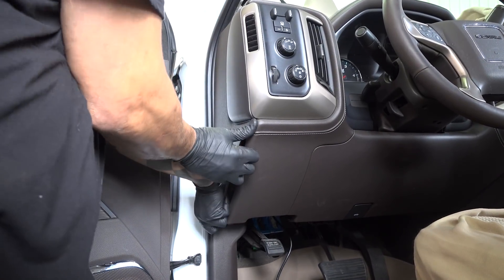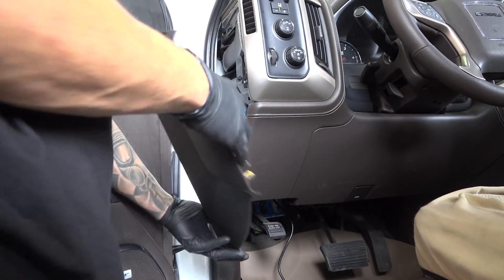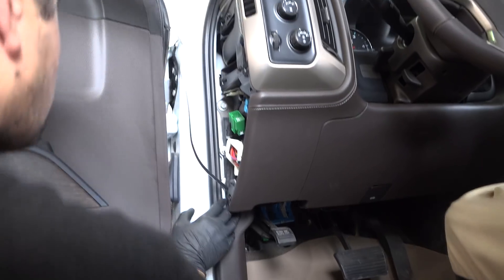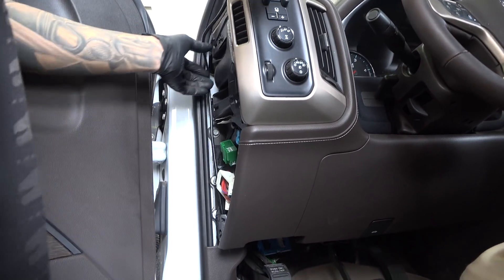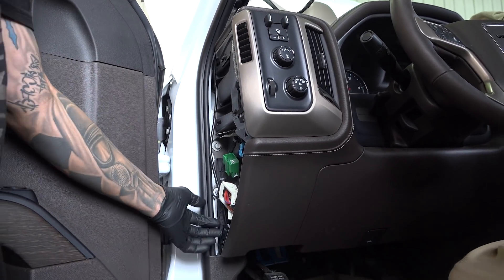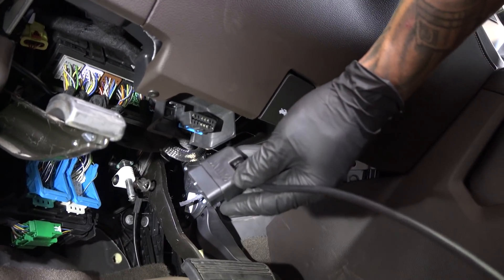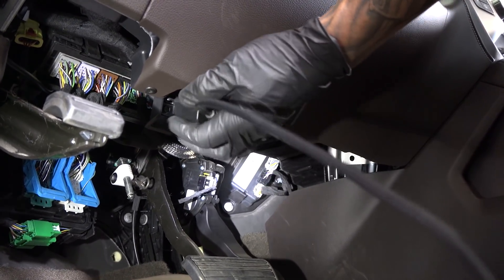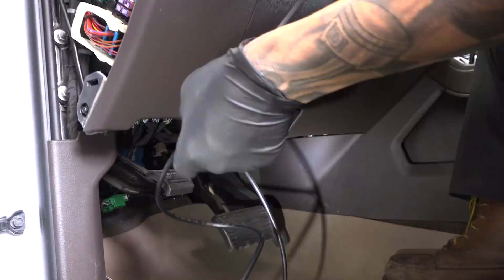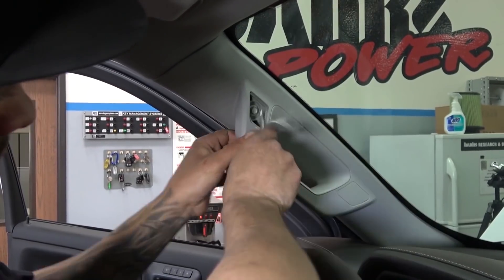Now move back inside the truck and remove the side of the dash — this panel normally hides your fuse block and is held on just by clips, so carefully pry it away. Route the starter cable up and over the emergency brake, then snake it up the side of the dash towards the pillar or wherever you're going to mount the i-Dash. Now plug in the OBD cable and follow the same cable routing path. Hold the OBD cable and the starter cable together, zip tie them as one, then take the extra cable, loop it up, zip tie it, and keep it stored in the side panel.